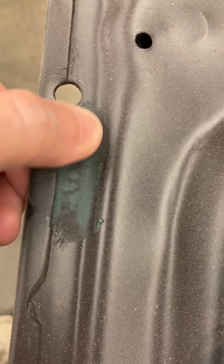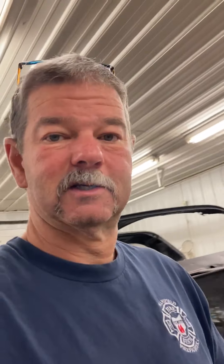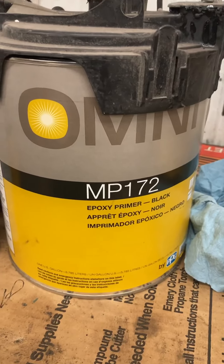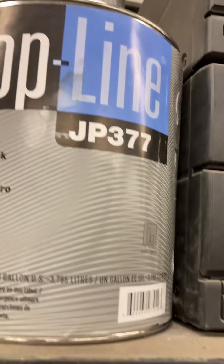Sometimes the holes are so small you don't want to get in there and be welding a bunch of crap because you end up just chasing it. The trunk lid — same thing, I didn't even weld there, it was just a spot. I like using the Duraglass. The fenders are good. The epoxy I sprayed — they didn't have the one I wanted for a while, so I had to get Shop Line, supposedly made by the same people. It looks fine — that's what's on the frame.